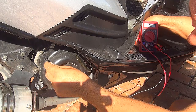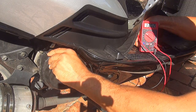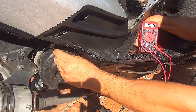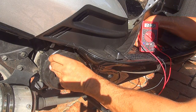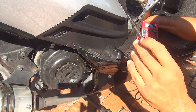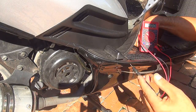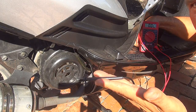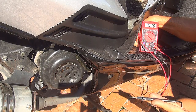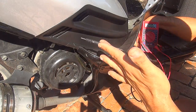The important thing that you should check is the voltage that you're getting in the motor, at the motor. Just by pressing the negative probe to the motor. So, if you get more or less the same reading that you get when you have the negative part connected to the motor, that is a great ground that you have on your scooter. Now remember, everything is connected to the ground. Even your horn on the system is connected to the ground. So if your horn is not working right, you could have some problem with the ground in the system.